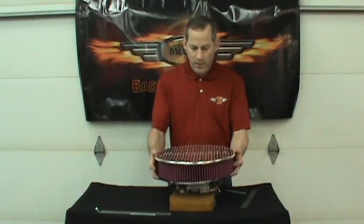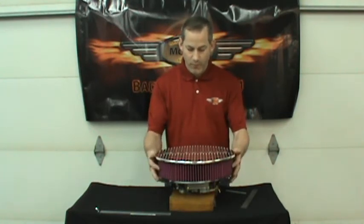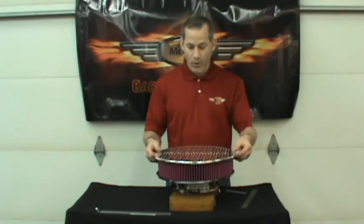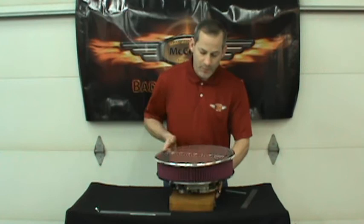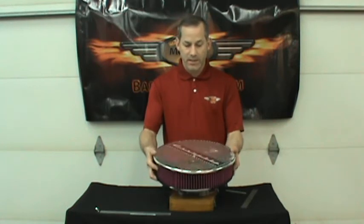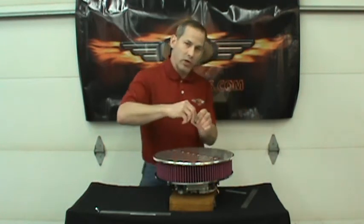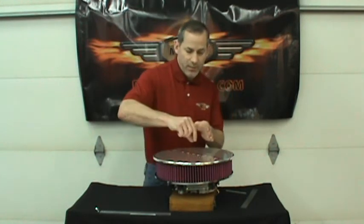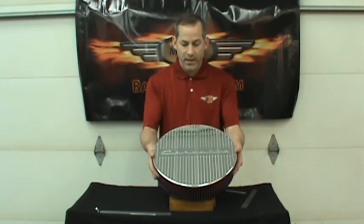When you're finished, you want this to be parallel with the car from front to back — straight — and from the side you'd want it to be square with the engine compartment. Let's say it didn't work out and it started to lock up in the wrong position. What I notice is I'm about 15 degrees off. I would want to back my screw up just a little bit, tighten it back down, and then by going counterclockwise it's going to take some of that slop out, and I can screw it back on and get it straight again — basically back to square.